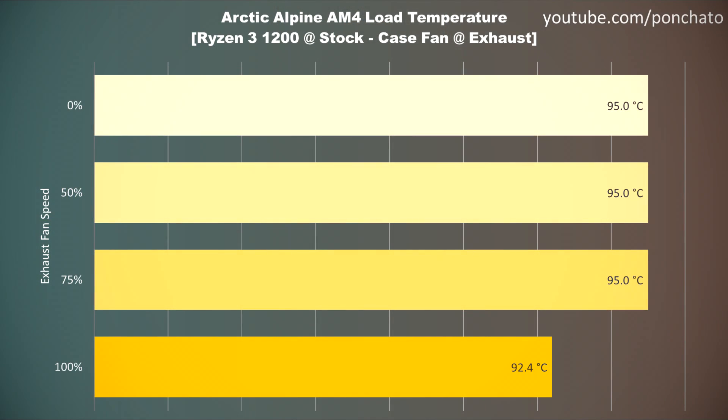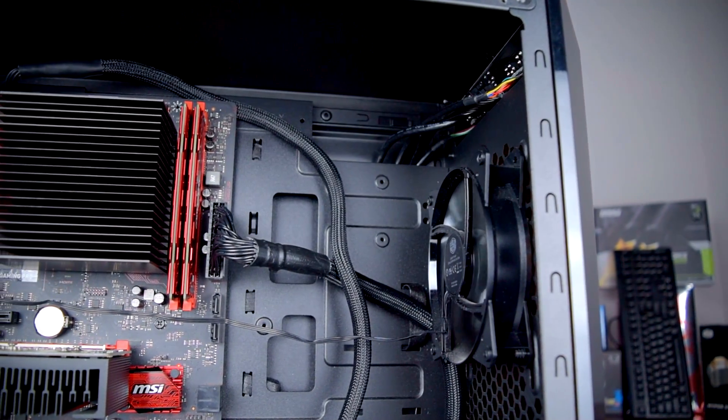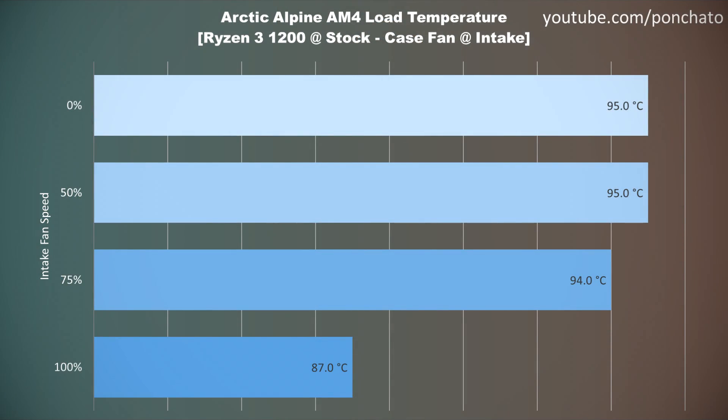The stress test is where things got interesting. I tested it with the fan off, at 50% speed, 75%, and finally 100%. With the processor running fully stock, it hits the 95 degree thermal limit at every exhaust fan speed except for 100%. The nice thing about running it all stock is that the processor will automatically thermal throttle itself at that limit so it doesn't get damaged, whereas if you overclock or specify a certain frequency and voltage, the system will just lock up once it hits that temperature limit. Even with the fan at full speed, the processor was still sitting at over 92 degrees Celsius. I was curious if having the fan at the front of the case blowing air over the cooler rather than pulling it away would improve thermal performance, so I repositioned the fan to the front of the case and ran the tests again. It actually made a pretty sizable difference — the temperature at full speed dropped by more than 5 degrees, down to 87 degrees Celsius. And even with the fan at 75% speed, the processor didn't throttle. It was only at 50% that the processor hit that thermal limit of 95 degrees.